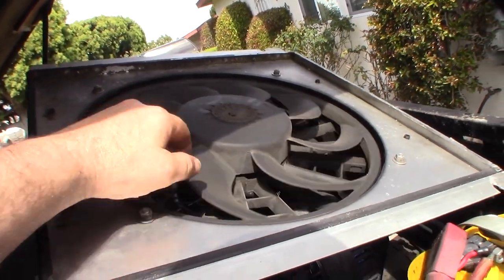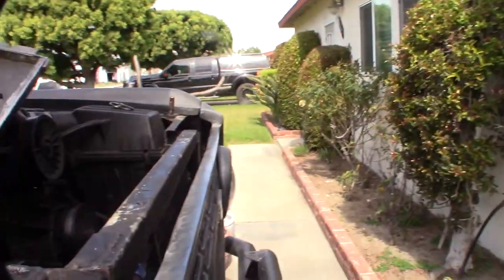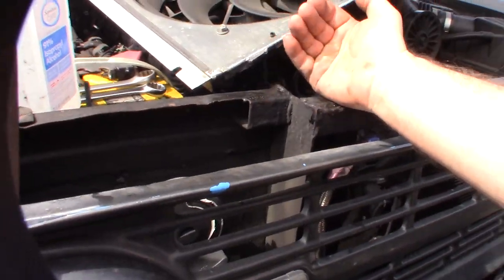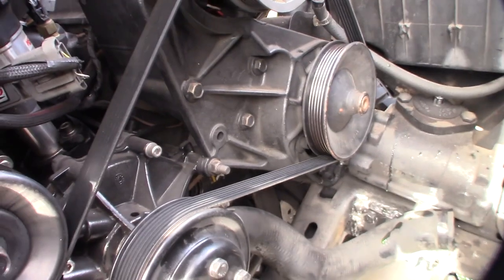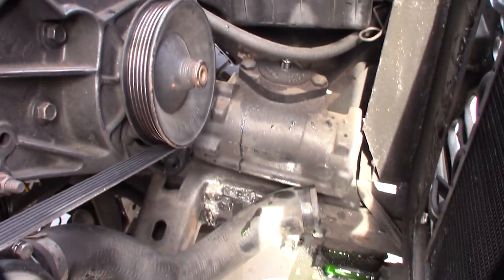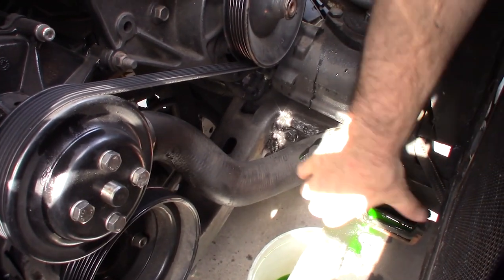If you're new to this channel, this is the original electric fan conversion I did — I got that at the junkyard and modified a shroud. I also brought the radiator forward and cut it to give me more room and clearance for the fan. That's one thing Broncos are known for — having no clearance between the fan and the radiator — so it makes a huge difference. Those brackets are originally for a three-core radiator and I kind of opened them up, so I decided to get the real, good, new ones.